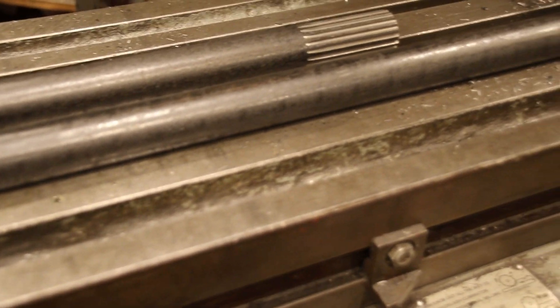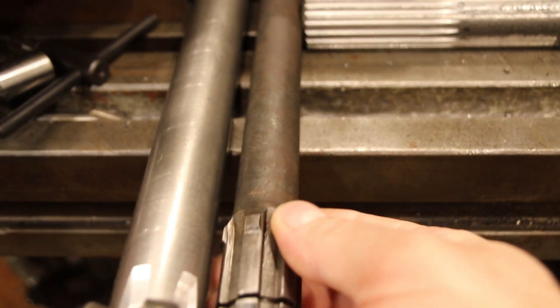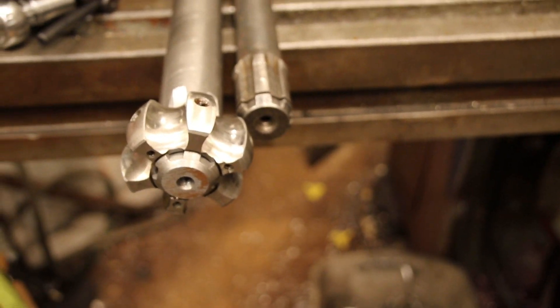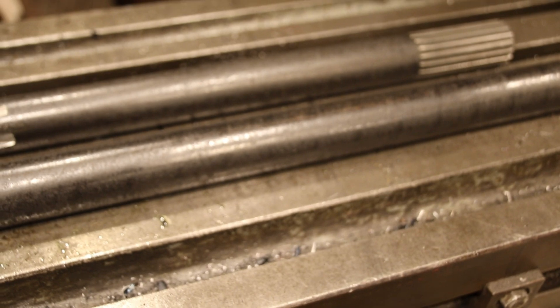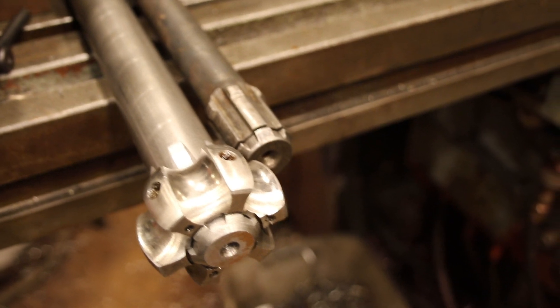Axle material can be a lot of different things. If you're not drag racing or off-road in a severe situation, you could basically use anything. Stock axles are made out of like 1039 or 1050 back in the day. 1045 is okay, 4140 is fine, 4130 — you can make them out of anything you want; heat treating is different on all of them. You can go down a rabbit hole on axle material. 4340 is good for front axles because it's got better twisting load resistance, not so much bending load. You might use 1541 for a rear axle where there's going to be bending. There's a whole lot of different stuff to know about axle shafts.